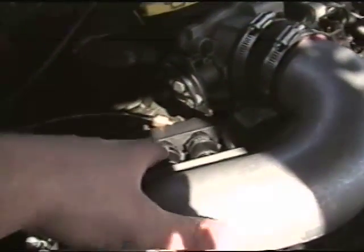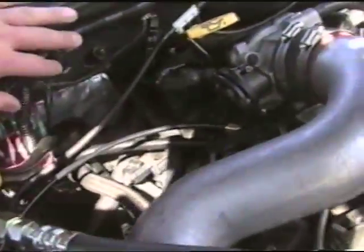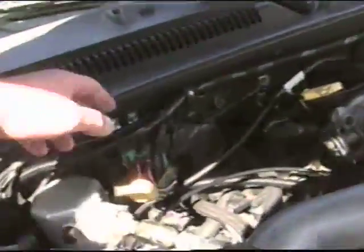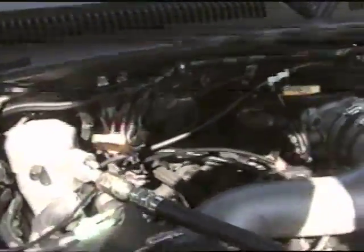We have standardized Bosch racing injectors for the alcohol, the delivery system, and the plumbing, put all the way back around. The injectors are controlled by the split-second computer — you can see the wiring coming up — and it's also designed to run a maximum of four injectors. We also have two relays installed, so when the low fluid alarm goes off, the injectors don't continue to pump and dry themselves out in case we run out of fluid.